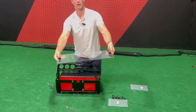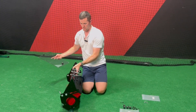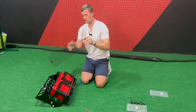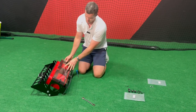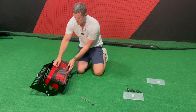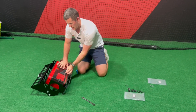It looks like this when you're bringing it up the ladder to attach to the bottom of the sensor. To envision it — this is what it's going to look like on the pipe. When you come up the ladder you'll have easy access to the bottom: reach up, push up against the bumpers, and as long as you put the side with more space up against this, you have almost no gap between the bottom of this lexan and the bottom of the other. Then take the four remaining screws — grab some extras just in case — and attach.